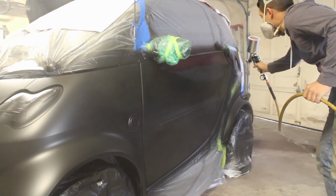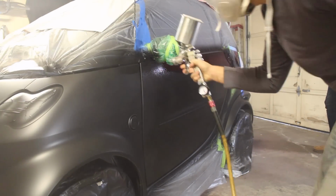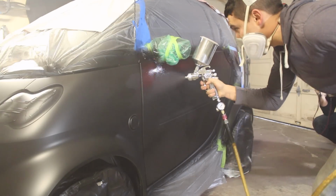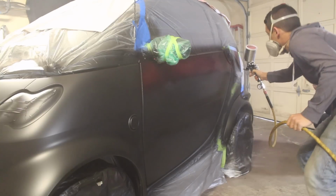You're going to want to spray the PLASTIDIP down just like you normally would. So if you're going for something like this, you want a base coat down and then follow it up with the DYC top coat with the thermochromatic pearls in them. I went with 50 grams per sprayable gallon, but later found out this wasn't enough based on my final results.